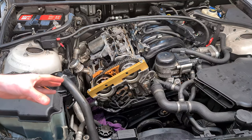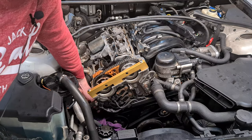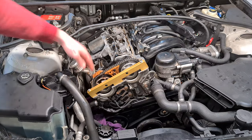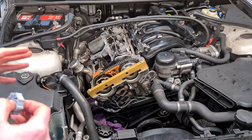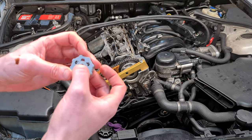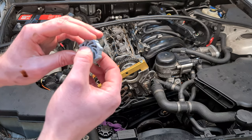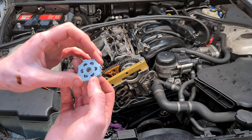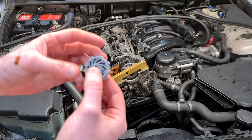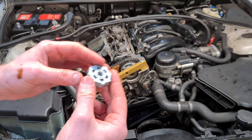And now we have to pre-tension the chain with the pre-tensioning tool that is already installed. The inner bolt in the pre-tensioning tool has to be tightened down to 0.6 Newton meters. And usually you don't have a 0.6 Newton meter torque wrench ready. So I've designed and 3D printed this little tool. This fits right onto that middle bolt in the pre-tensioning tool, and it is calibrated to torque to 0.6 Newton meters. If you want to make one, I will put a link down in the description to the 3D model, and you can print it out and calibrate it to 0.6 Newton meters if you need to.